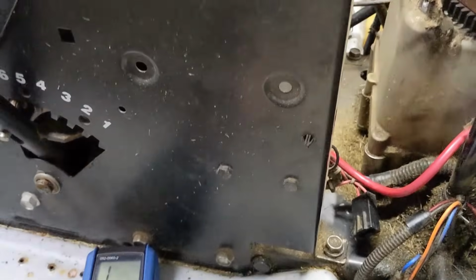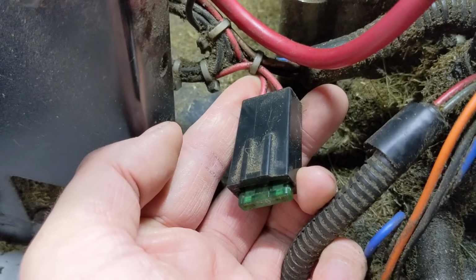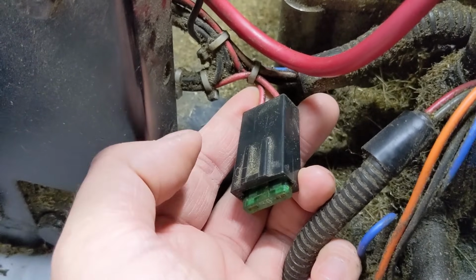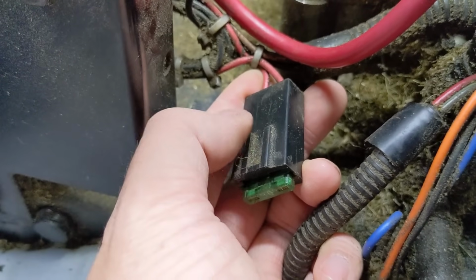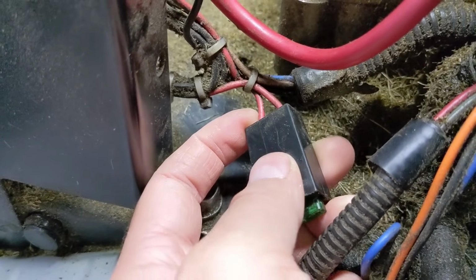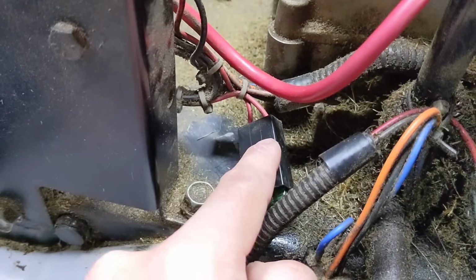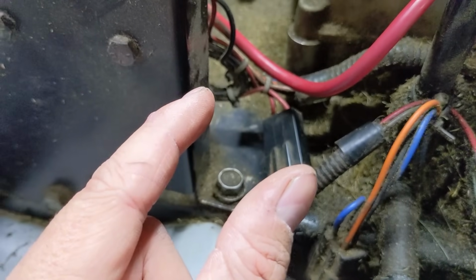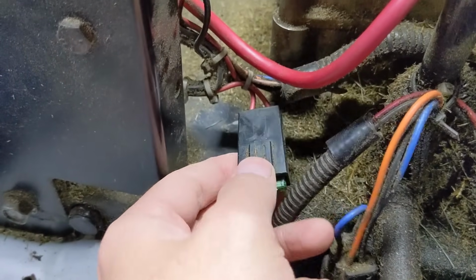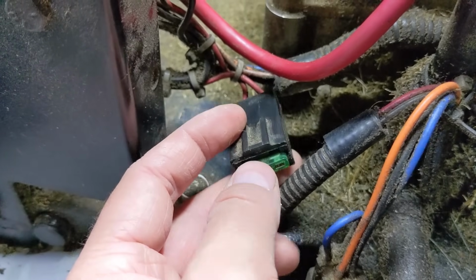So in the event that you don't have 12 volts at that little white wire there from your key switch, go ahead and test your fuse. Now, if you tested your fuse and the fuse tested okay, you could go ahead and make sure you have 12 volts coming in and coming out of the fuse box, because I recently worked on a lawnmower that had a lot of corrosion built up in the bottom of the fuse box. So I had 12 volts coming in and I had a good fuse that I inserted in, but because there was so much corrosion, there was actually no 12 volts going out of the fuse box, because two of the prongs on the one side had seized in the open position. So when I stuck the fuse in, it wasn't making a connection. Basically, I had to go in there and clean up all of the corrosion, and then I used some Permatex dielectric grease to go in there, and that prevents corrosion on electrical components.